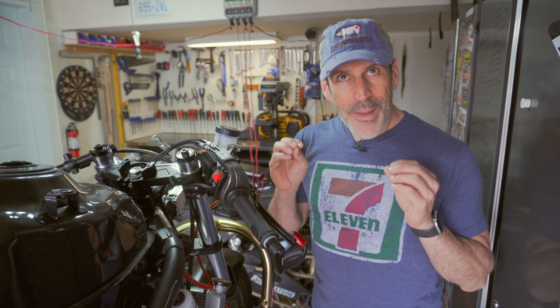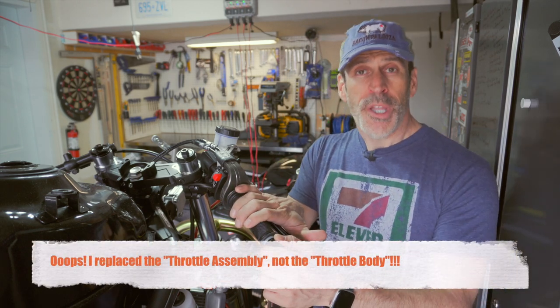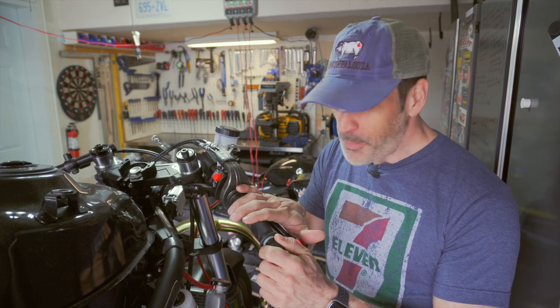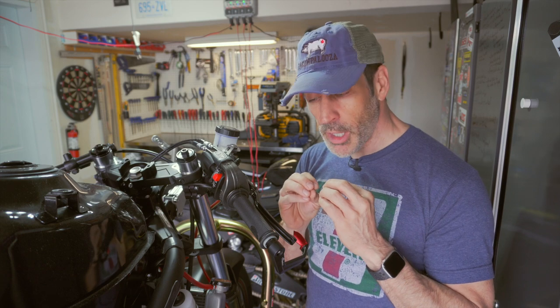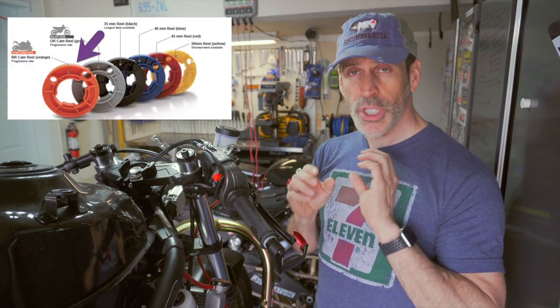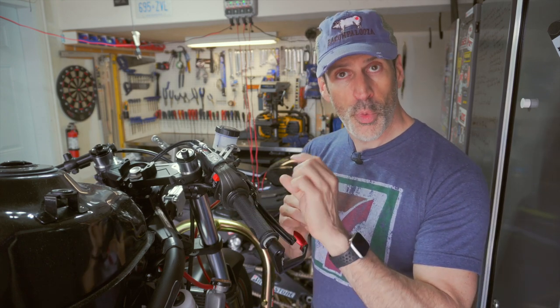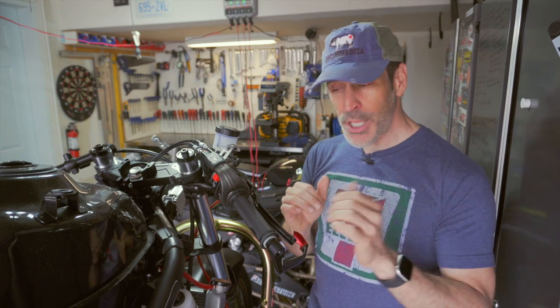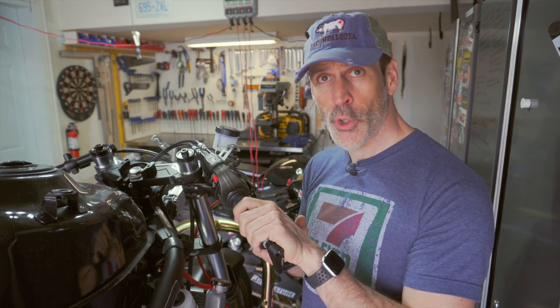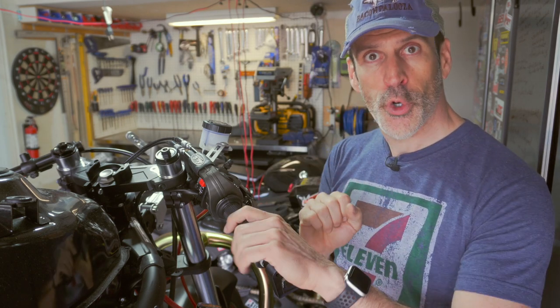The reason why I'm doing all of this is because I replaced my throttle body and my throttle tube with the Motion Pro Rev 2 kit. I am using a progressive reel — the orange reel for those of you who know Motion Pro. It's a progressive reel that allows me to have better control at low speed but get really quickly up to top speed or open throttle within a much shorter throw. The result of this is that you have to apply a lot more force in order to get full throttle, and that soft pull return spring will allow me to require less force to open up the throttle.